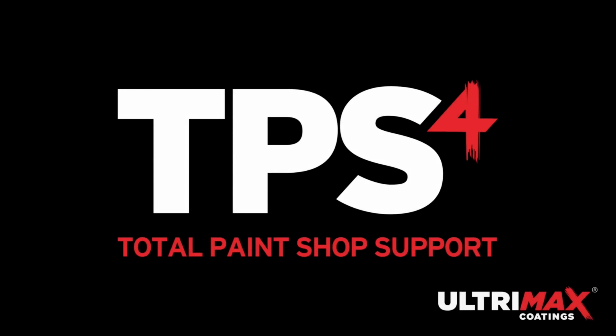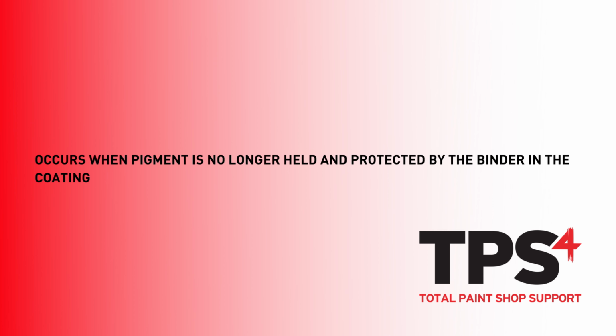Today I want to go over how chalking in your paint finish is caused, how to repair it and how to prevent it from happening in the first place. Chalking, or otherwise known as fading or weathering, is when a chalky white appearance is visible on the surface of the paint film, and this occurs particularly when using epoxy coatings as a finish coat. Chalking occurs when the pigment is no longer held and protected by the binder in the coating, which then results in a powder-like surface and a lack of gloss.